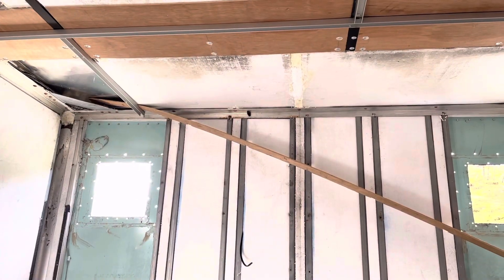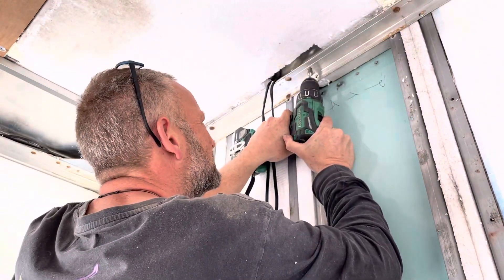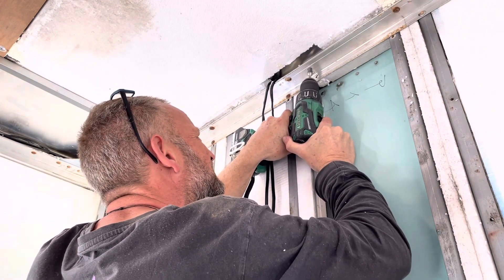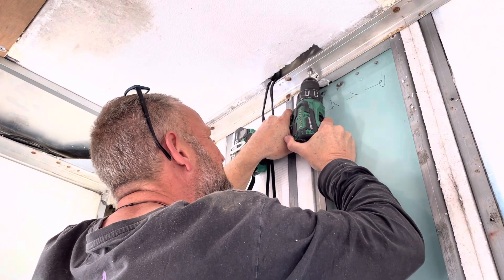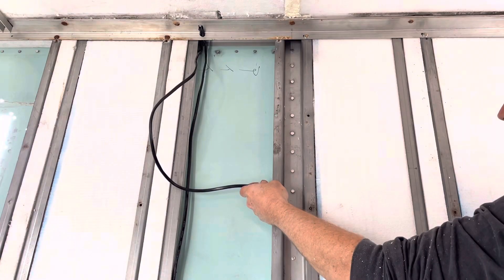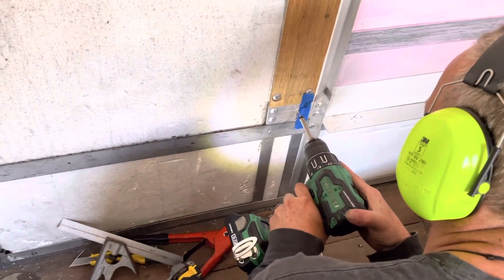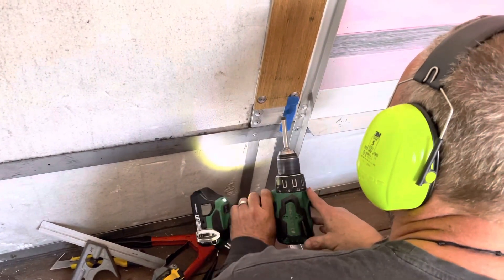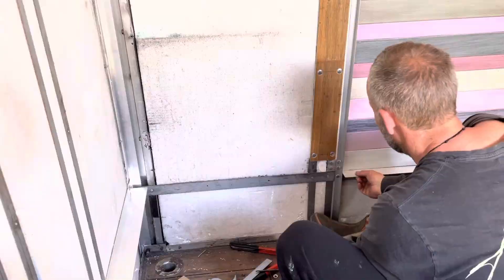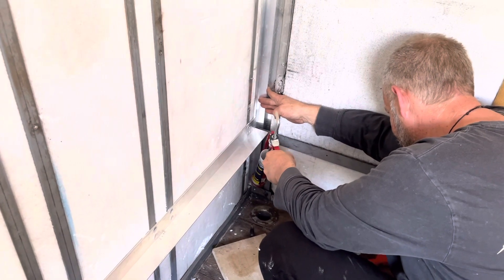Both vents are removed and we've got two holes in our truck. We didn't like the positioning of these wires so we decided to move them because they would show through the ceiling and wall panels when put into position. Jason's just using a grinding tool on the drill to make the holes a little bit shallower so the wires will fit tighter to the wall and ceiling. Jason's just deburring this hole before we reinstall the wire. Next we had to remove a section of this piece of 50mm aluminium which we'd made too long. We decided the best way to do this was to drill tiny little holes in a straight line. We'd already removed the rivets so it's just a matter of prying it off. Now we can tidy it up with a little bit of filing and replace the insulation. Now it's time to finally install this angle in the corner.